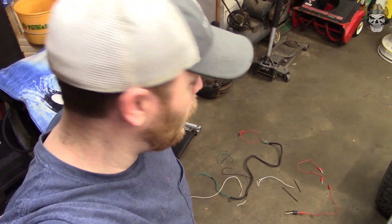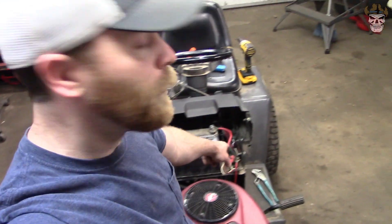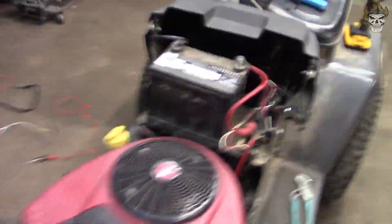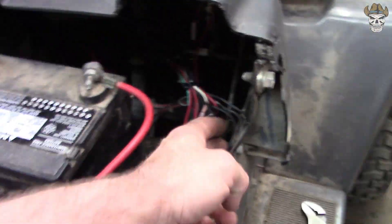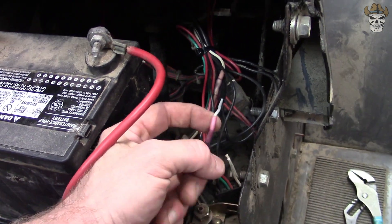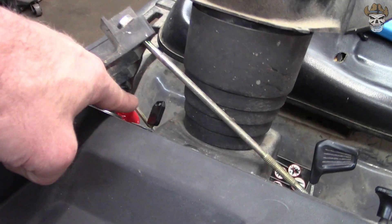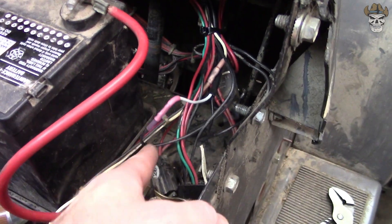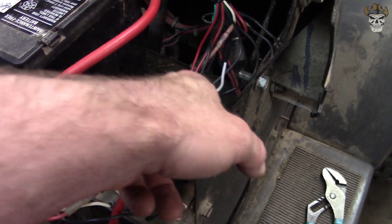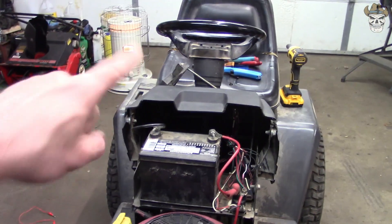There we go - I cut quite a bit of wiring out. The green wire, the big long one that snakes through here, was the rear seat switch - I just cut the green wires and spliced them together, and the white wires got spliced together. That was for my starter solenoid. On my brake switch down there I found one of the black wires that grounds out the coils, so I used the factory ground right here going to the tether and then tied that into the white wire. That's the white wire from the tether going to the black switch from the foot switch. Now I have a kill switch working and all my starter wires are jumped - let's get this battery bolted down and test everything.